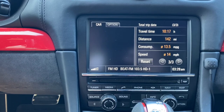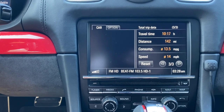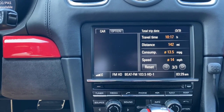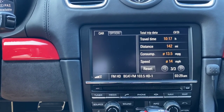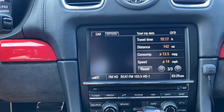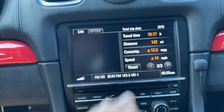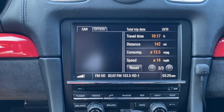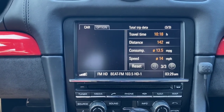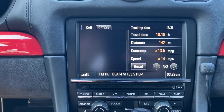In addition to that, the actual angle of the camera is now sitting at 60 degrees versus 85 degrees on our previous cameras. So if you think of 85 degrees pointing more downward, we now have 60 degrees — the camera lens sits a little higher even though it's in the same position on the bumper, so we get less of the floor in the image.